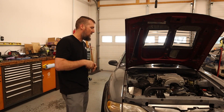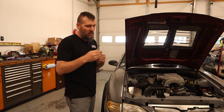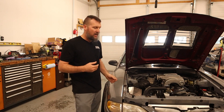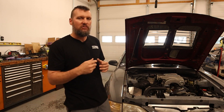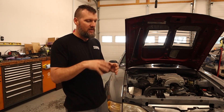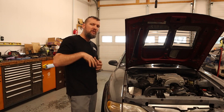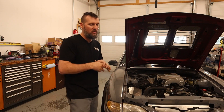There are three steps. Step one, after we get the car started up, is to go drive the car — just partial throttle kind of things. We'll try to hold a constant mass airflow value and ride the brakes to load the engine and get some higher values. We'll finish step one with a second-gear half-throttle pull up to shift RPM. That step will take a couple iterations and is mostly focused on getting the fuel dialed in. Then we move on to step two, which is a wide-open throttle pull — a second-gear WOT all the way to shift RPM.